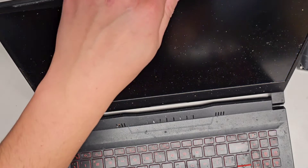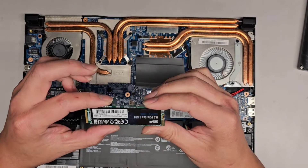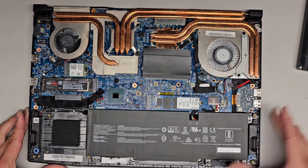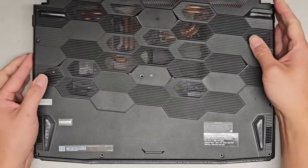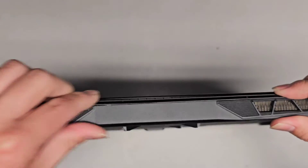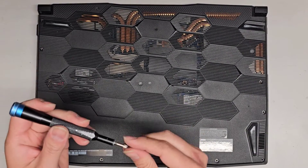I'm going to turn this off. I'm assuming they want their data, and hopefully the only bad drive is the one we removed — when I ran a disk check it just died, so most likely we got the right drive. Let's go ahead and reassemble this, then we're going to install Windows on it and we should be good to go. Get the bottom cover, line it back up, click it back into place all around, and let's get all the screws back in.